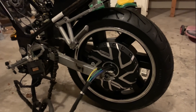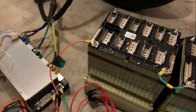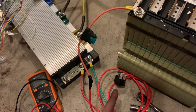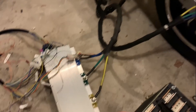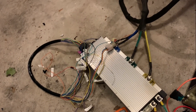So I have it all hooked up and I'm going to attempt to wire up the throttle and then give it a spin. This is not the final configuration, but I have it running at low amperage just so I can test it out — low volts. If anything happens or is wired wrong, this fuse will blow. I also have a kill switch if something goes wrong or shorts. You just want to make sure everything is as safe as possible. Once I get the throttle wired up I'll show you guys the bench test. I'm going to do another video going into more detail on the wiring because that spaghetti wire is pretty difficult to figure out without any wire diagram, which are not provided, so I'm going to try to draw one up for everyone.